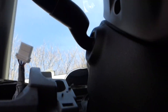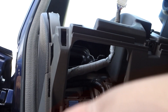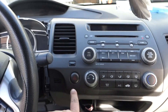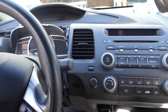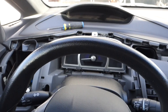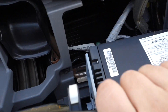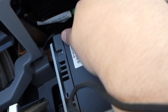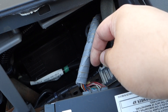There was one screw to get that off. There's a panel here that you just pull down on — it's held in with tabs and will come right down. Once you do that you can take that piece off. Again, make sure you let the car heat up; if you're pulling on something too hard there's probably a screw holding it down. Once those came out, all you have to do is pull at the top and it should come right out.